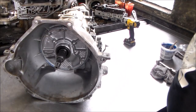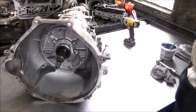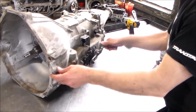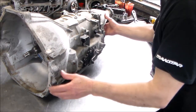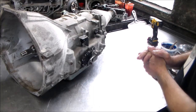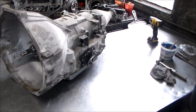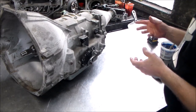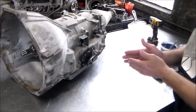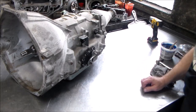Okay, so that is all on this 2012 E150 Ford van with a 4.6 4R70W. Rebuild is complete. And once again, we were dealing with blown planets. Actually, the cause of the problem was that the bearing in the back of the direct drum was blown because the snap ring broke. And I believe, again, that the output shaft pushed up against it. It probably ruined the bearing. And then it just kind of snowballed from there.